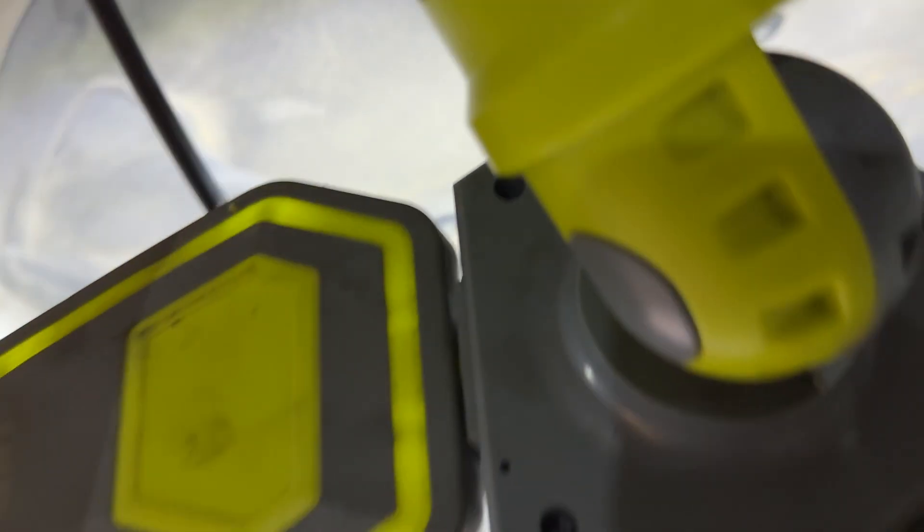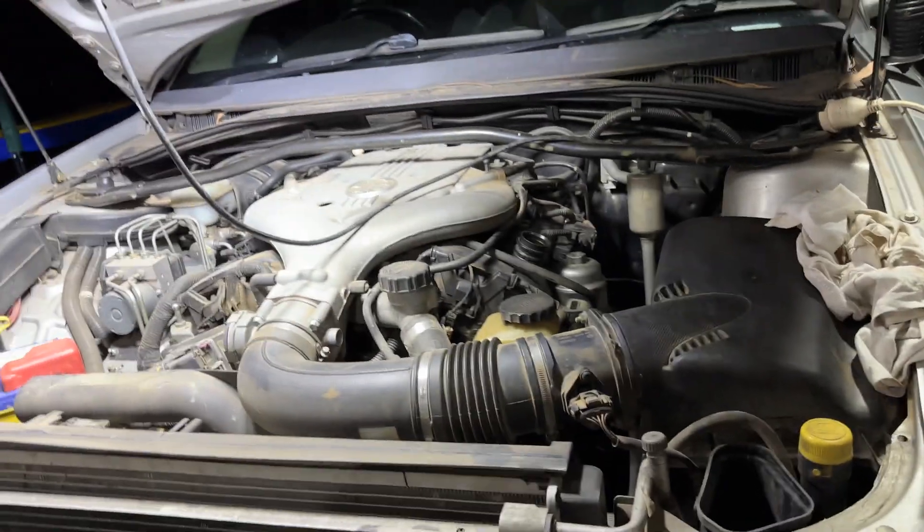So we're going to have to have a look. I'll have to check the PCV. I don't understand though, because my oil pressure has been fine — oil pressure seems to be fine. That's why your engine is still running, because you've got at least good oil pressure. But I reckon you've got poor crankcase ventilation.